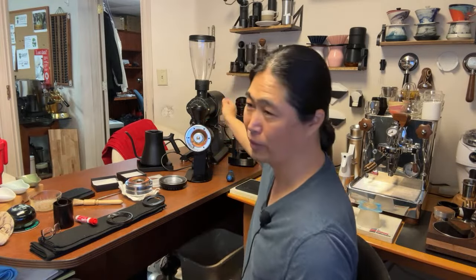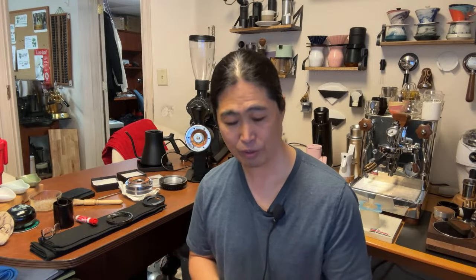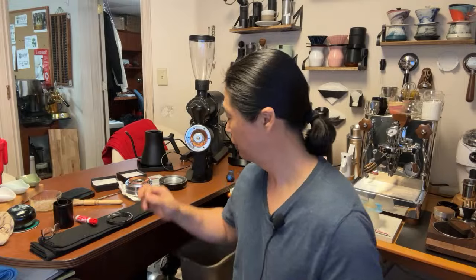So, the next thing I gotta do is, hold on a second. Some people say 70% is good enough for me. Yeah, 100% is, again, hard even on my EK43, a $3,000 grinder, behind my DF83. I have to put shims in, okay? Even that grinder, I gotta shim it like 4 or 5 times to get an acceptable alignment. That's why, even for the EK43, you can buy a separate burr carrier from aftermarket. That costs you $500, just a burr carrier. So it all depends on what you want. For me, 85% wiped, that's all right, okay? But again, I think I might add another aluminum foil, just kind of play with it. So let's go for like 90% or 100%.